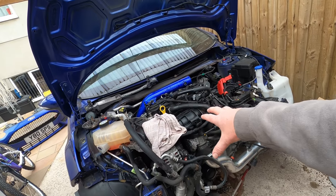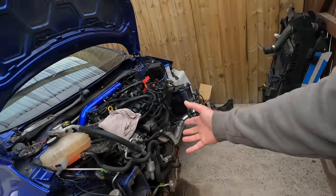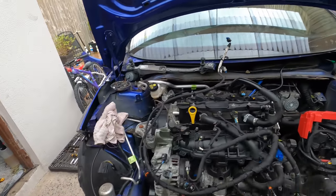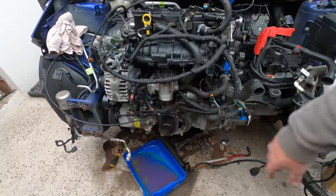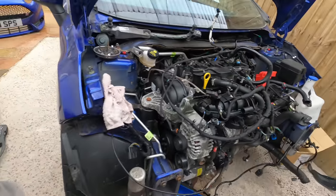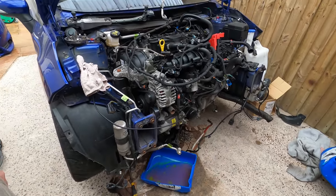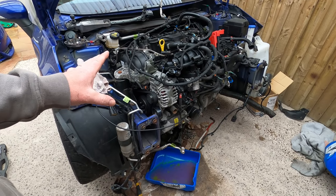I've got a lot to work through — I'm going to get the wiring harnesses off and get ready to start pulling that head off. I'm not taking the head off right now because I'm going to drop the engine out as a lump with the gearbox. That'll be a lot easier. I did think should I just pull the head off as it is, but I know you want to see the state of that piston. The engine and box will come out together, and once I put everything back it'll be a lot easier this way.